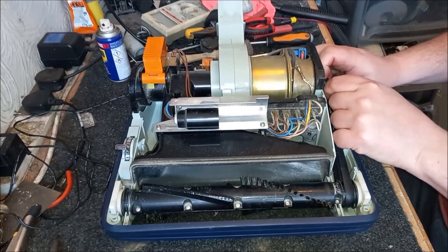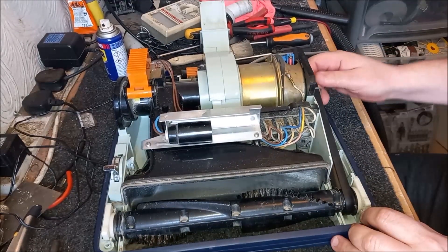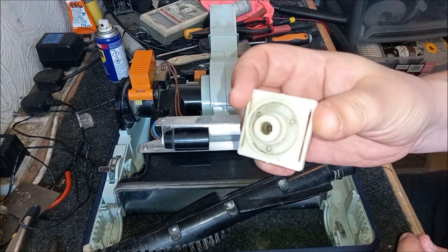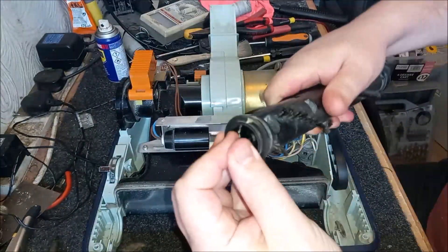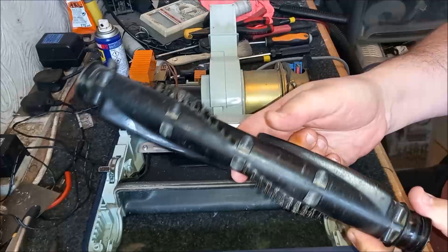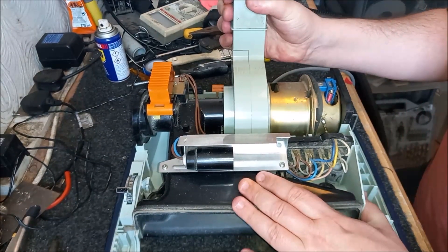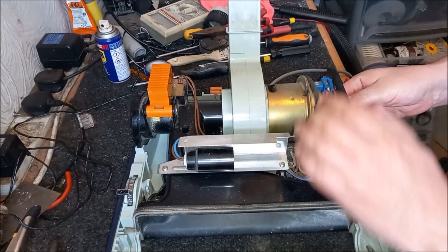The belt is not too bad. They've got this guide to stop it from chewing into the side of the hood, but it's difficult to get out. Let's get the brush roll out first. So non-ball race bearings on the brush roll — just sleeve bearings. Let's pull that out and look at the brush roll itself. There's a tiny bit of play in the brush roll, but we're never going to get a replacement so we'll probably have to live with that. This seems a bit loose — you can see that moving. That ain't right, and I suspect that may be one of the reasons why we have the vibration.